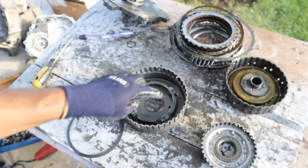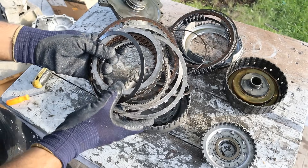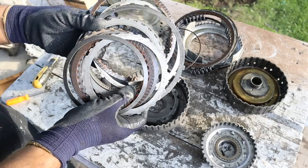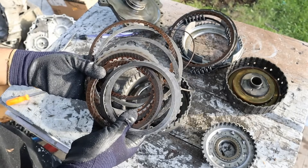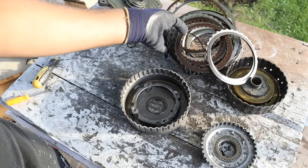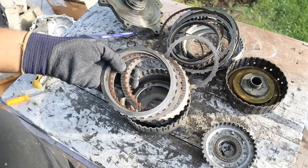The advantage of CVT is that the belt does not have as much friction as a clutch set like this in an automatic transmission. In a regular automatic you'd have about four or five clutch packs, whereas in this one you just have two, and clutches when they're not applied do create a bit of drag — so you can see how this design is a lot more efficient.